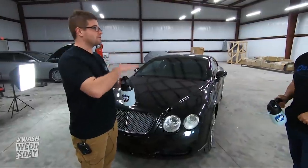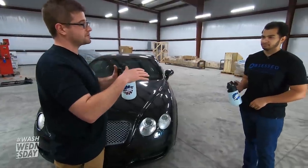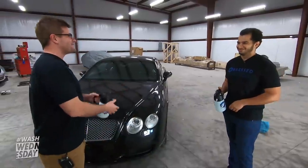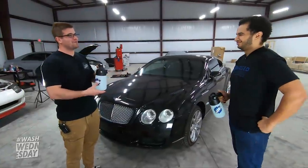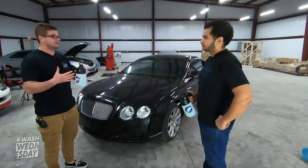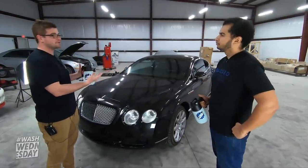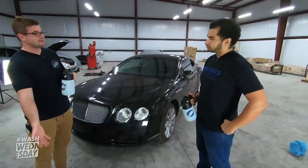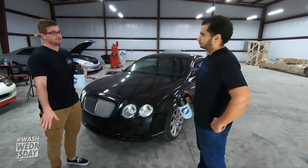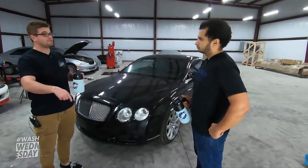We're gonna pre-spray with that O&R solution because it contains polymers. These things clean is what they do. They're gonna encapsulate and pick up dirt. And then we're gonna use a nice towel that is also soaked in O&R to pick up that dirt. Using the multi-towel method, that dirty towel is never going back in that bucket.